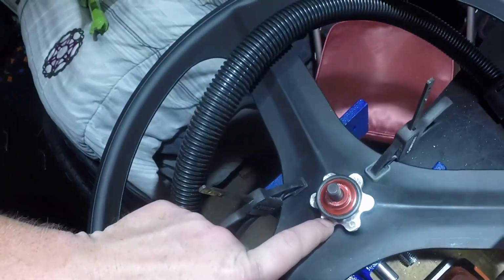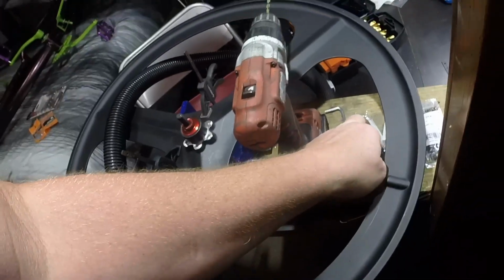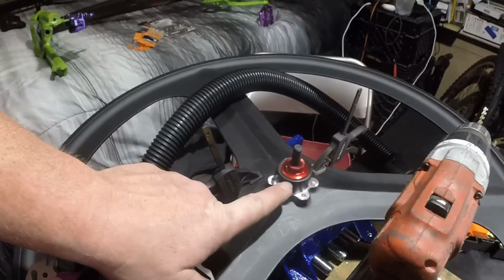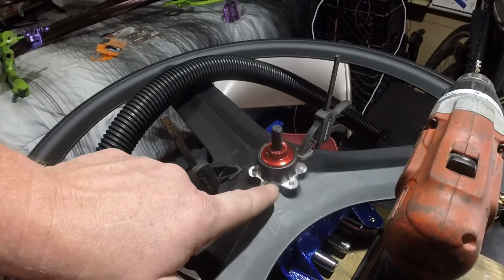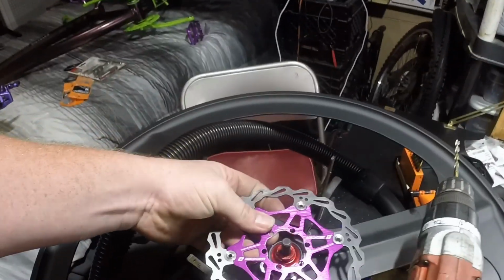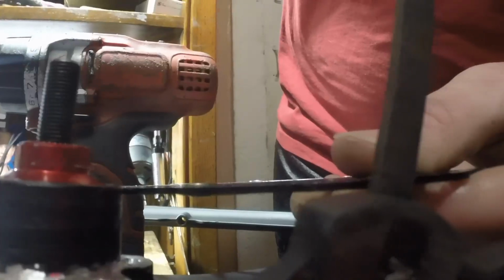So the rear ones are set up so that I can use them with a rotor, and whatever adjustments I'll have to make from that. The front one, see what I'm doing? I flattened everything out so there's a nice flat surface. I'm drilling it out, then I'm gonna tap it. I went to the hardware store and I bought the bolt. On Tweaker, I believe these are all the way up here. So I need to raise this up, basically right about there. See how far down it is? It's about 17 to 19 millimeters, about 18 millimeters, okay? So I have to make them about 18 millimeters.